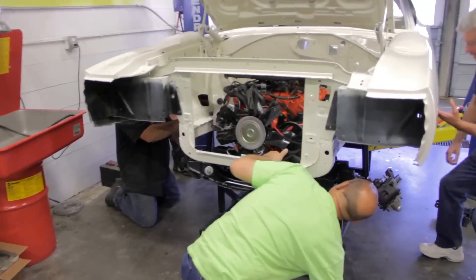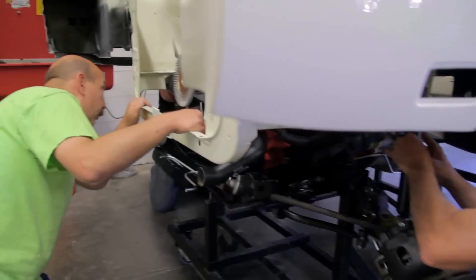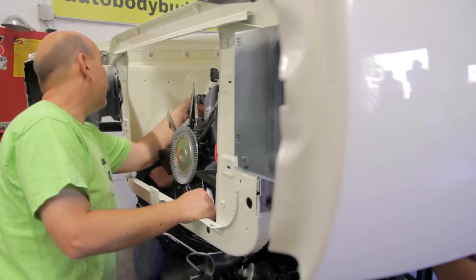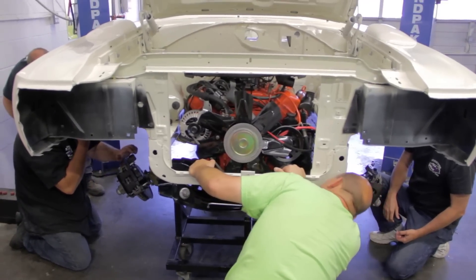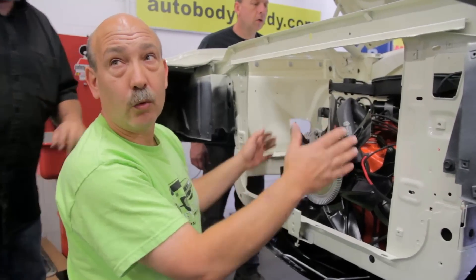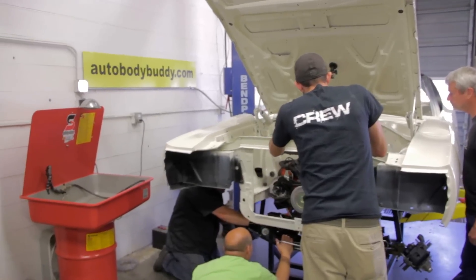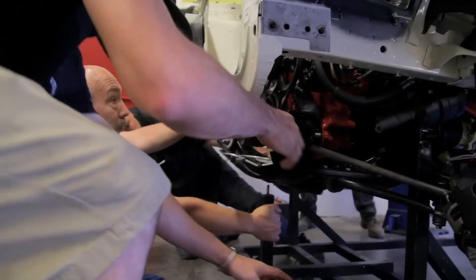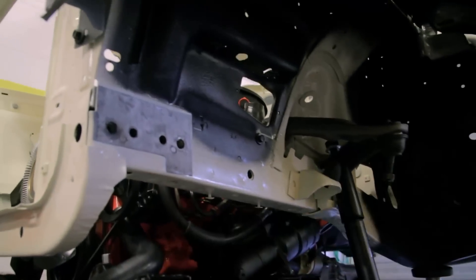Guide that shock in over there, Darren. We're getting ready to lower the car down onto the motor. Mark's got the shocks on him — everything's built out. They're always a tight fit, but with the shocks on there, it's just something else we've got to watch as it's going together. We don't want to have to paint anything else. I've got a problem with this manifold and the steering gear — it's like the steering gear's sticking over into the rail like a half inch. It's almost like the motor's got to roll to get it to fit up in there. The only real problem we're having marrying the two together is that it's a really tight fit. Sometimes it will just glide between the right-hand exhaust manifold and the steering gear, and in this case it didn't.